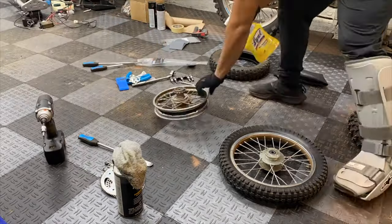And here's the Kelly controller that's been pre-programmed by Electra & Co. This is the brains of the bike. This is what's going to replace this standard style 33 amp brushless controller that originally came with the kit. This is what draws the power from the battery and delivers it to the motor. And this is what made the biggest change in top speed for my 72 volt bike. It's definitely very important to have a good quality controller, so I'm excited for this.